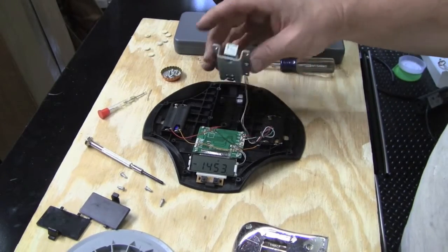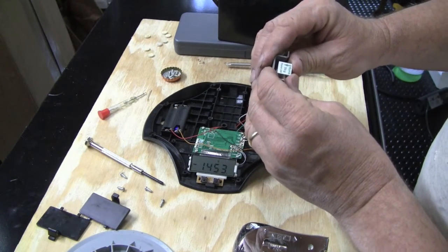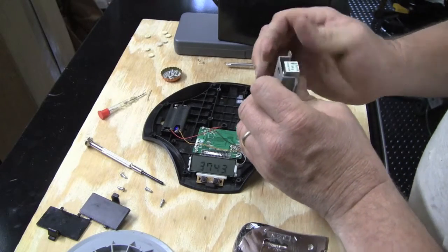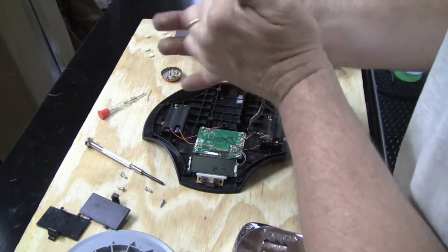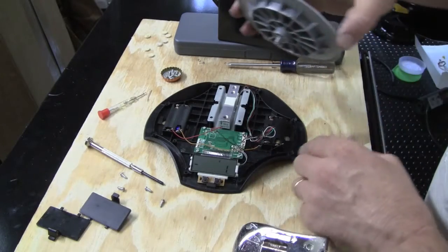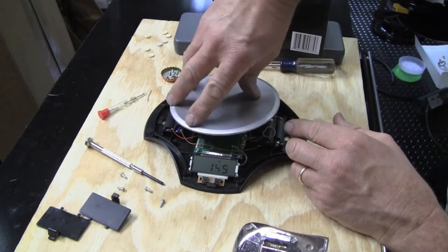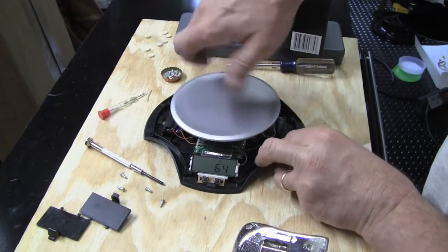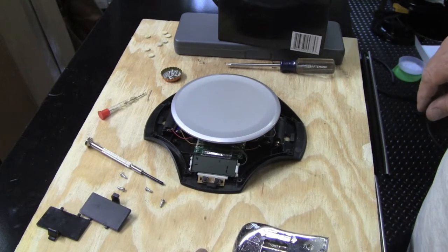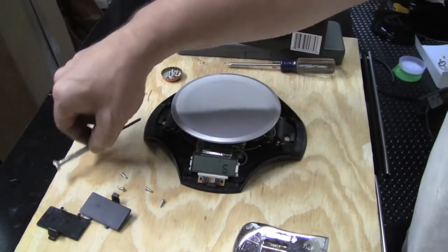Okay, I'm back. I think what happened is I bent this too much, because it will work with a lot of weight on it but won't zero and weigh very small objects. So I'm just going to bend this thing back — I'm not sure if I can do it with my hands, but let's try. We'll see if it will zero and weigh something very small. Let's try it again — screw this on, tell it to zero. It zeroed. That looks more like it — it weighed something very small.